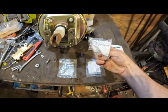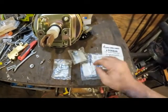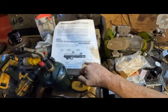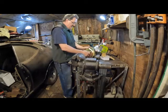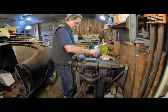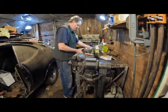See these other ones? The 1/2 for the 3/16 line. And this one has the 9/16 for 3/16 line. And as you can see, you're going to need 9/16, but for 1/4 inch line, if you have the same kind of car I have. If you have one of these other models, I don't know what's the line. When it comes, these things are not on there. You have to put them on the right way. The master cylinder is on the brake booster as it comes from the kit, through the mail.